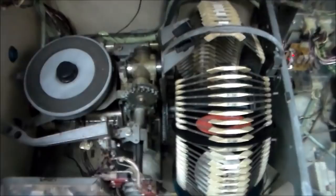Like, see, it's got a little play in it. You can mess with it and pull the piston in and out and pour oil all over everything. And basically, you'll get oil in there and it will clean it up. This one was jammed up whenever we started, but we poured a bunch of oil on it and let it soak, and it got it where it's moving.